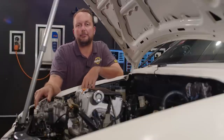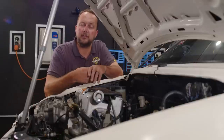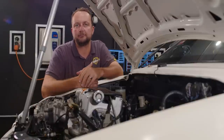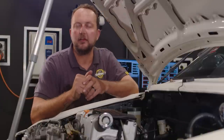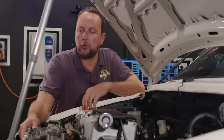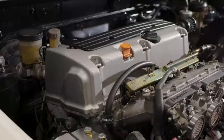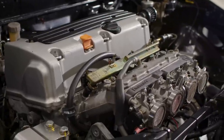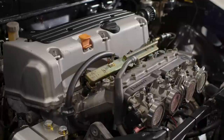We must have that manifold pressure sensor if we're going to tune the thing using volumetric efficiency or VE-based fuel modeling. As for individual throttle bodies, well, the verdict's still out for me. I absolutely love the look of them. The availability, these things offer Yamaha R1. There's plenty of donor bike engines and parts around because, let's be honest, the bikes don't last that long.